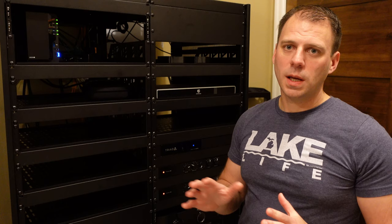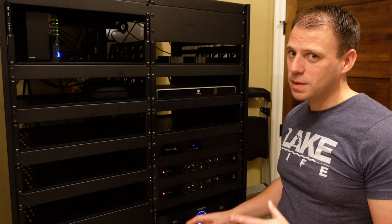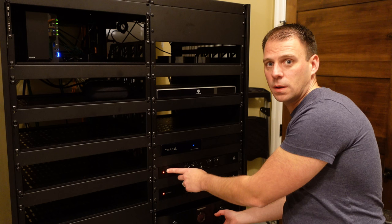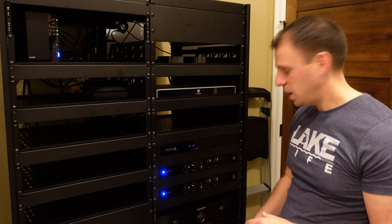Let me demo this real quick. If I turn on my Marantz — you heard the clicks — that's the Emotiva coming on. Awesome, perfect, reliable. If the main zone of the Marantz is on, the Emotiva is on. Turn off the main zone — Emotiva off immediately. For Zone 2: you can see the red lights and no extra light on the PAMP1. Turn on Zone 2 — blue lights, we're all online. Done with Zone 2 for the night — turn off Zone 2 — and off. This is absolutely the way you want to run your system.